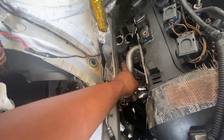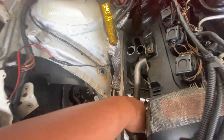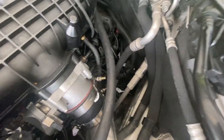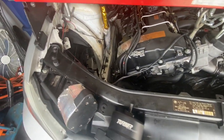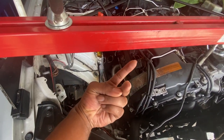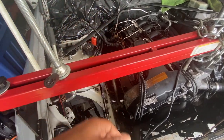I think I'm just going to go ahead and relocate it and just be super careful with how I fill it up. With the single turbo kit out of the way, it's easy access to grab the top bolts on the passenger side. I'm going to loosen those, and then way down in there you can see the other top bolt for the passenger side mount. I'll take those off, and then underneath the car there will be another two sets on that side — take those off and I should be able to lift the motor up a little bit and wiggle it right out.